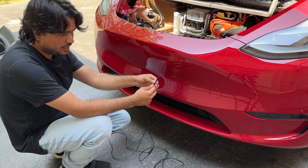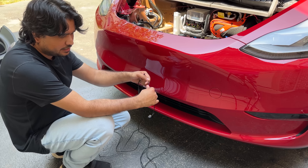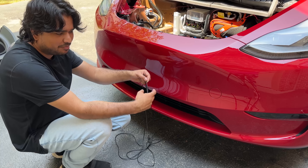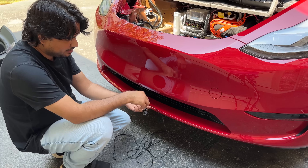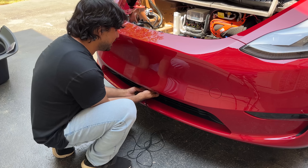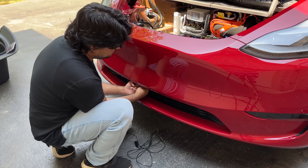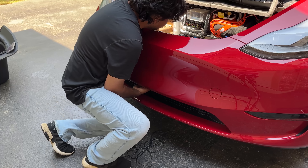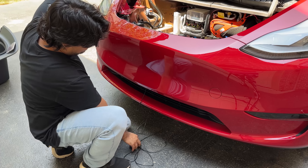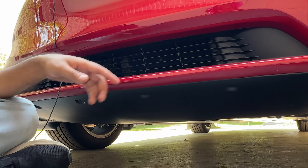Here's the camera and here is the camera cable for the front. Other camera kits have an additional input and output so you can run an extension cable — this camera does not have that, which is probably a good thing because that connection can come off. So there's going to be one long cable that we'll be routing. Tesla actually helped me identify the midpoint because they placed the vents accordingly.